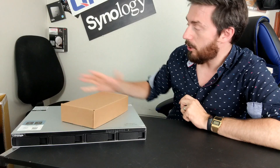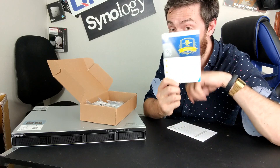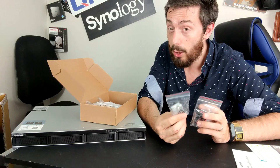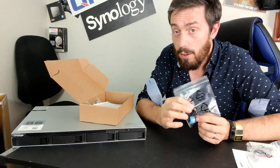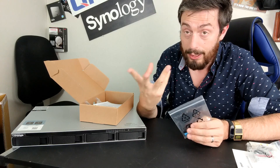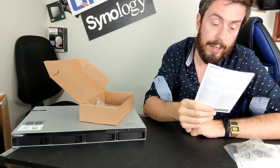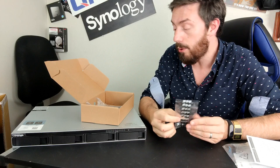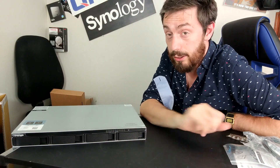Here's what you get in the box. Inside you've got your quick start installation guide, extended warranty information — the device arrives with three years of manufacturer's warranty that can be upgraded to five — screws and handles for rack mounting, and heat sinks for the internal SATA M.2s, both of which can be used for raw storage or caching. You can fully or partially populate — add one drive now and another later. There are also screws for 2.5-inch and 3.5-inch media, two RJ45 Cat5e cables for LAN connectivity, and a PSU cable, because this has an internal PSU as it is a rack mount.